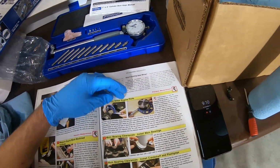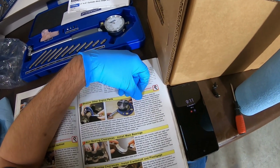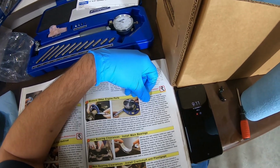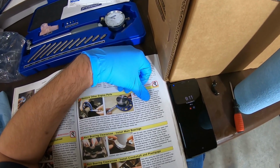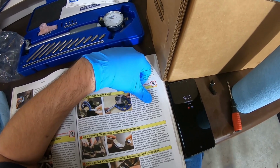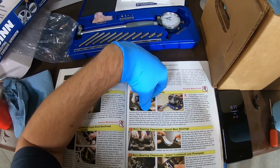Measure other engine parts. It will be helpful to check the roundness of other critical surfaces, including but not limited to crank journal diameters. Inspect for taper and out of round and connecting rod bearing bores. This is especially true if your machine shop didn't have much of a hand at preparing these, i.e. they are new aftermarket parts.